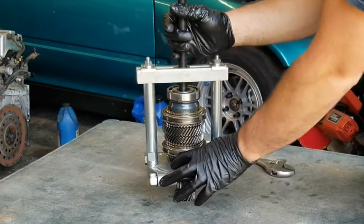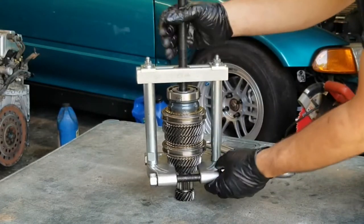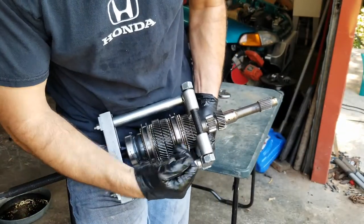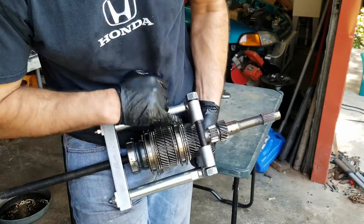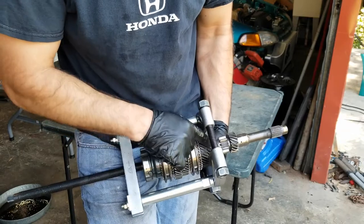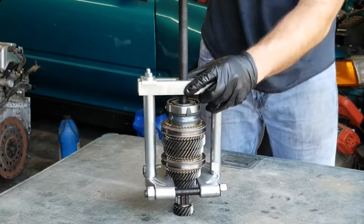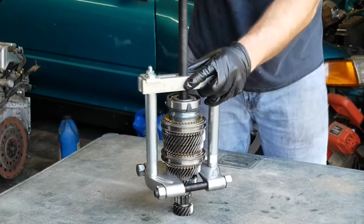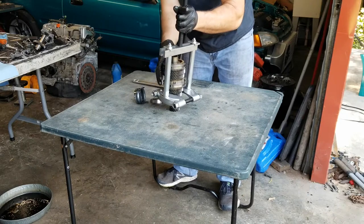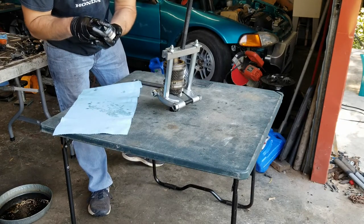We're going to use this to pull the gear stack apart. I've put the separator down here on — I believe this is third gear. Second gear is attached to the shaft. I've got the puller flat side up on the bottom of this gear but not touching second gear — all these free float. Second gear is attached to the shaft though, so we're going to pull the whole gear stack up. The best way to do this is as you take everything off, leave it in order — I usually flip everything upside down so I know when I reassemble.